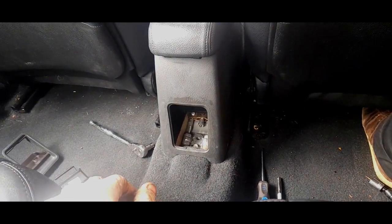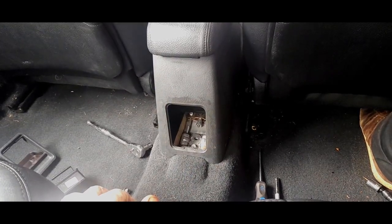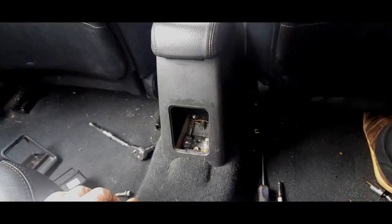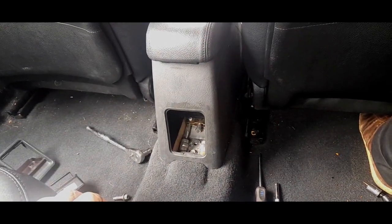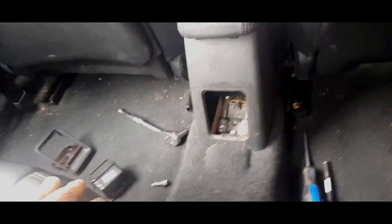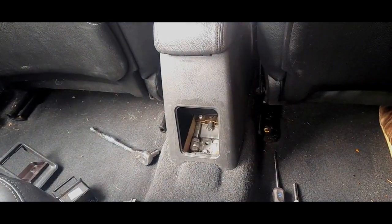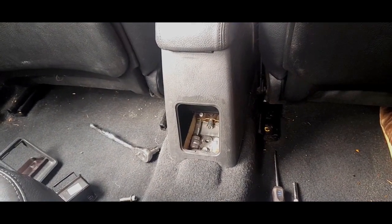All adjusting the cable does is tighten the cable - that's it. If the handbrake is well adjusted but the calipers are not working, the wheels are still going to be pretty loose. What you're doing is asking the handbrake to stretch itself so that the brakes actually come on - that's not going to work, it never works. You've always got to make sure the brakes are correct at the wheel. We're going to put it all back together, check the other wheel, and then we can start bleeding the car.